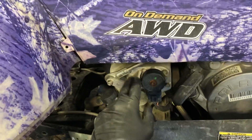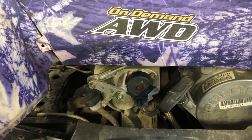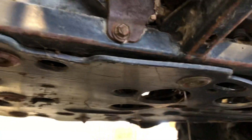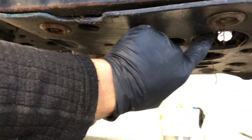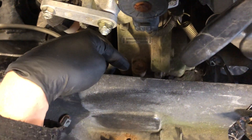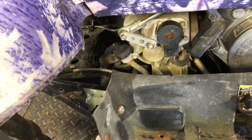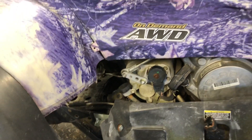While we're on this side, to change your transmission fluid you'll use an 11-millimeter wrench to drain the oil. Come down here — there will be a larger hole in your skid plate where you can drain your fluid using the 11-millimeter wrench. To refill the transmission fluid, you've got a 14-millimeter bolt down here. Check your manual for specs on that, or ask in the comments section and I can get you those specs.